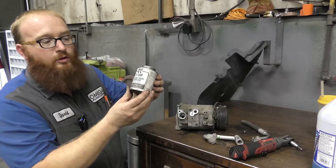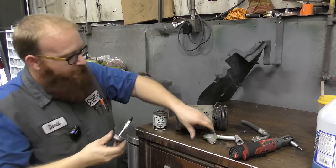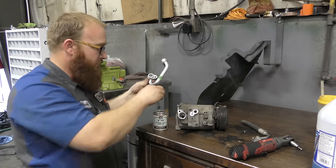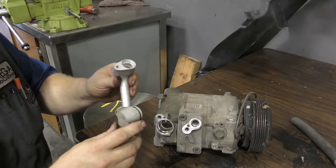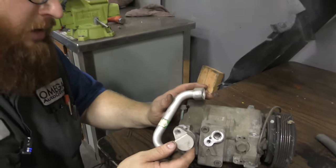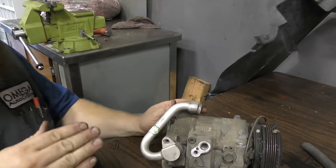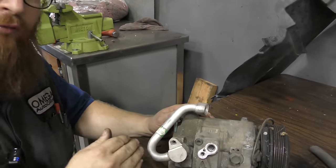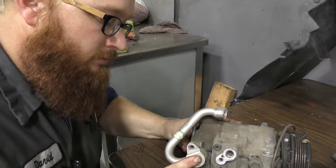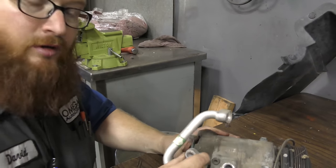You put the right O-ring on and use a lubricant. I use X100 silicone lubricant — it's inert, it doesn't react with anything. Always put some sort of grease or lubricant on your O-rings; I recommend silicone because it's inert. Now we've got the O-ring lubricated. You insert until you feel the resistance of the O-ring — it should never be resistance all the way down, bouncy like a rubber balloon. You should feel a small pop, which means it properly seated into the port.